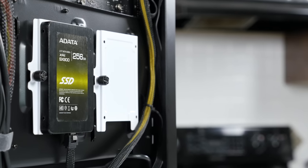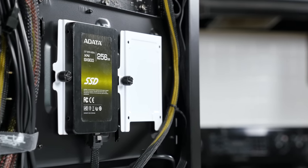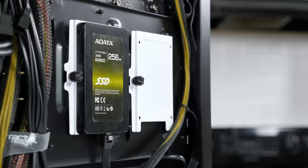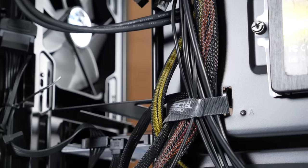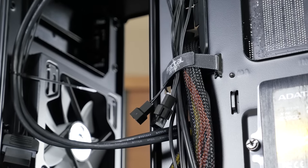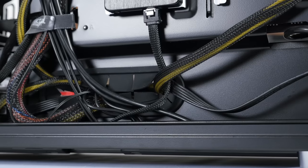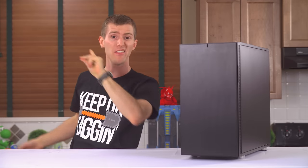But there's more positive stuff to make up for this oversight. The SSD mounts on the back of the motherboard tray are better than the older screw-through-the-MOBO-tray system I've seen Fractal use. And as far as cable management is concerned, the Define R4 was cruising for a good to very good ranking, with ample zip tie loops, lots of room in the right areas behind the motherboard tray to route cables, and included Velcro straps.